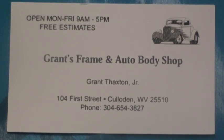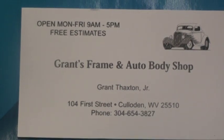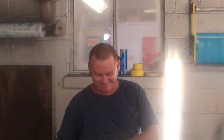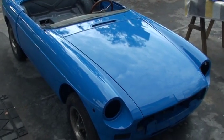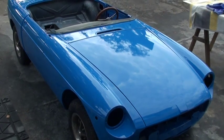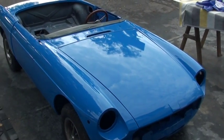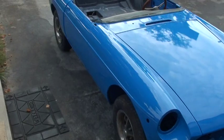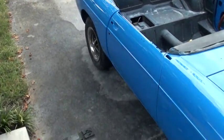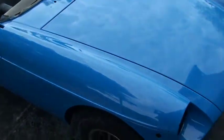For anybody looking to get their car painted, there's his contact information. Grant, as again, did a real good job. Any last words, Grant? Thank you. Got it back from Grant's this morning. We're going to go ahead today and get some 2000 grit sandpaper, wet sand and block out the clear coat to knock out any imperfections that may be in the clear coat — as far as dirt and any overspray and so forth. But other than that it looks pretty good. We're going ahead and get cracking.